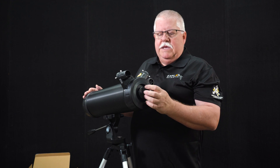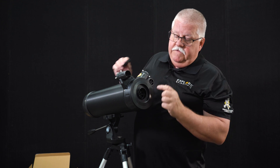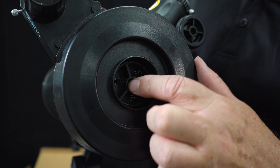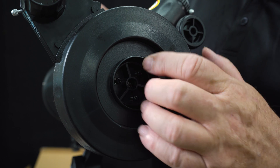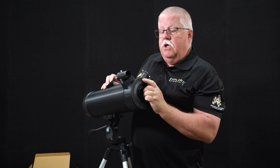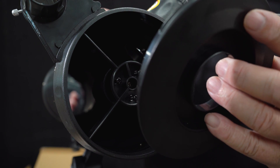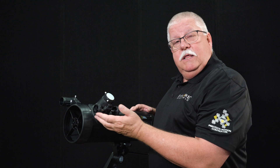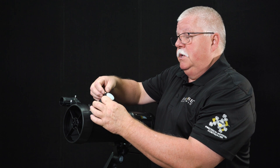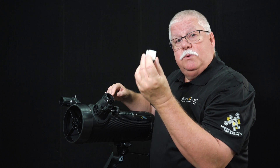Now we'll remove the lens cap. The design is a two-piece affair — a smaller lens cap comes off, revealing a circle with three screws in a triangle and a small screw in the middle. Do not turn these screws. To get the lens cap off, use your fingers and pry off the larger lens cap. After it's been on and off a few times, it comes off much easier. This part of the telescope is the focuser — it comes with a white cap installed to keep dust out. Turn the two silver screws to remove the white cap.